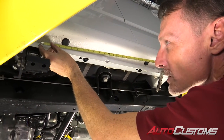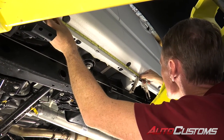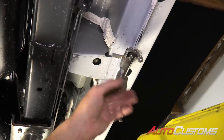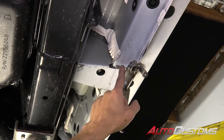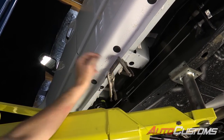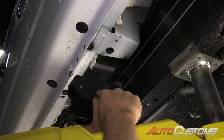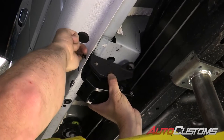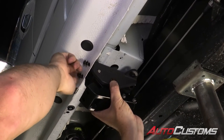Now measuring from the rear-most bolt on the front bracket back to our template, it should be 29-1/2 inches — actually it comes out at 29-3/4 inches to where that first hole is going to be. Whenever we set the bracket in place, it just misses this extra thick piece of pinch weld right here, so we're still right in place. We're going to go ahead and drill out our pinch weld holes exactly like we did before, then shoot some paint on and protect them. Now we're going to grab the idler linkage bracket — this is the one that does not have the motor attachment. We're going to line up the threaded holes to the holes in our pinch weld and use the exact same hardware that we used on the front, setting it into place hand tight. We're doing this temporarily so we can line up the hole in the back that we need to center punch and drill.